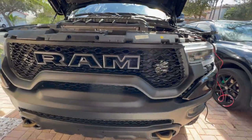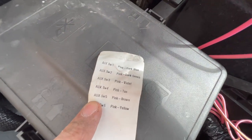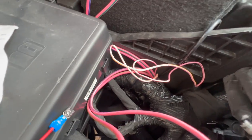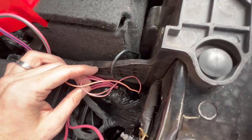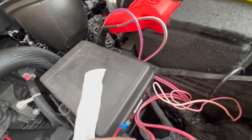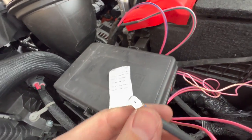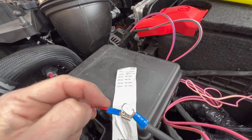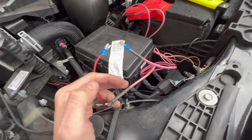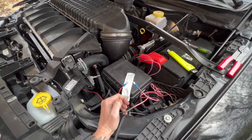We're in the home stretch now with the final wiring. You want to read the little diagram here to figure out which aux switch you want to wire to - it shows colors like yellow and pink corresponding to the wire you want. For my two smaller gauge wires, I'm already using those for rock lights and LED wheel rings. So for this one I'm stepping up to switch three and four. Put a quick disconnect on the corresponding side so I can connect it, then the same on the other one, put both into heat shrink to protect from weather. That should be it.